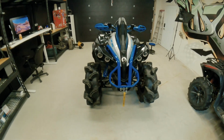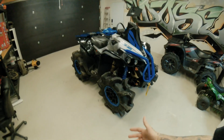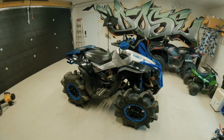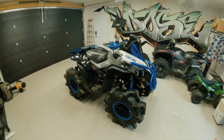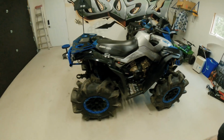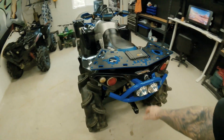They're ridiculous, and this thing is just an absolute monster. I'm almost done with it. I don't think there's a whole lot left that I'll do, at least with the kilometers on it right now. Once it gets to around 7,000 to 10,000 kilometers, we'll probably haul the engine out, redo the top end and put a big bore kit in. And at that point, that's probably when I'll go in with the new header pipes to go with the exhaust.